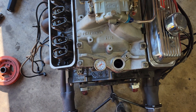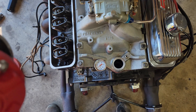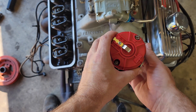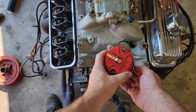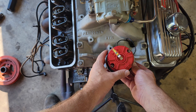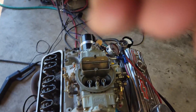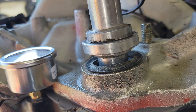I've got the distributor cleaned up, the distributor gear lightly oiled, and a distributor gasket on. What we're going to do here is place the rotor facing towards the second bolt from the back on the driver side. If you had a vacuum canister, you're going to want to set it between the last two bolts on the passenger side. Set it down — it is sitting on top of the oil pump drive shaft at this time and has not fully seated. Let's get that fully seated.